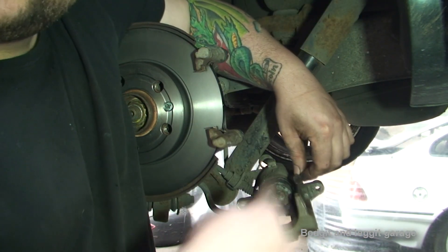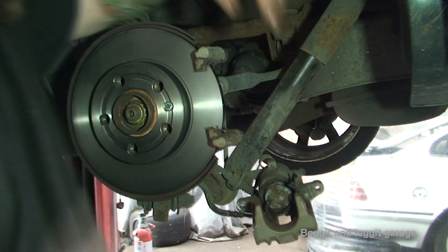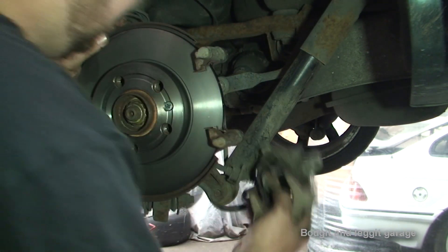We're going to change the caliper because it's all rusty and stuff in here — it's half seized and it's not going to be long until it completely goes. When you wind back the caliper, you do have to be careful of this rubber seal. Make sure the caliper is twisting freely and the rubber isn't moving. What happens is the rubber sticks to the piston, you turn the piston round, and it basically wraps itself and breaks. You need to make sure only the cylinder is pushing back. We do have the handbrake cable on this, which makes it a little bit trickier.